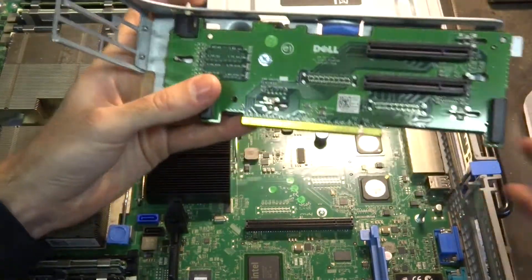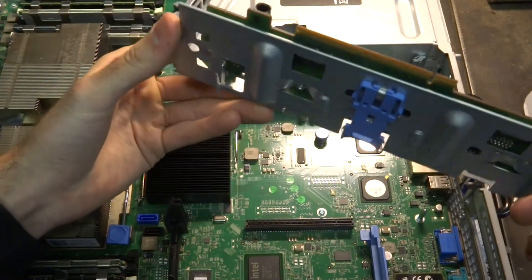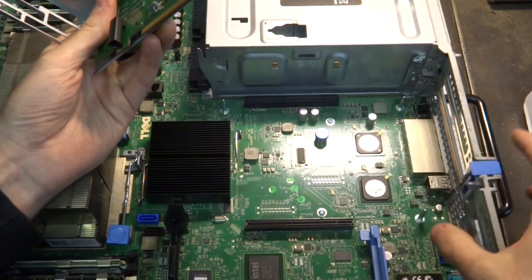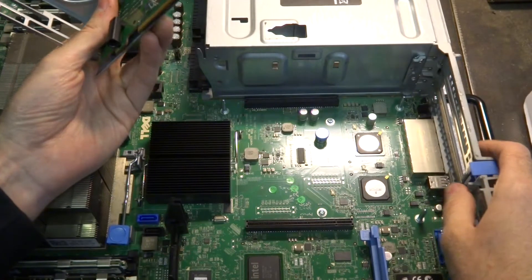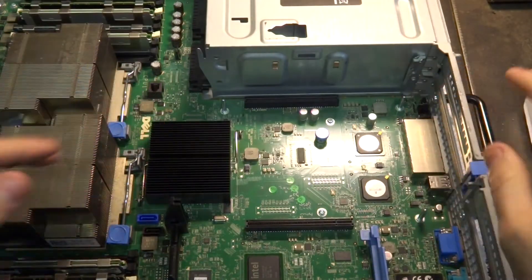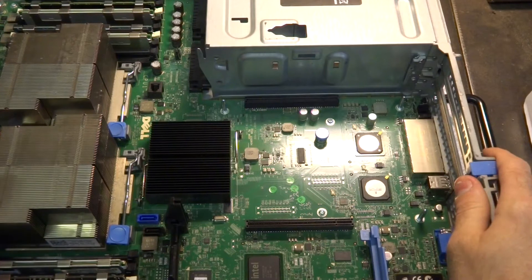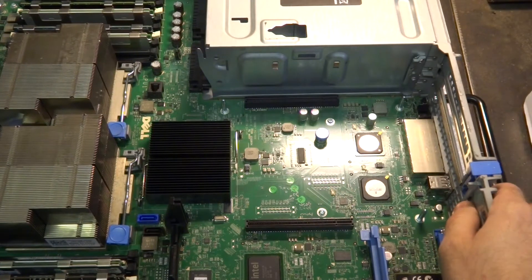It's a shame, because if it didn't have the intrusion switch, you could easily get a PCI riser cable and put in a two-slot height card in here, which would be much better. Maybe there's a way around it — if I can find one I will, because I'd like to get a graphics card in here to do some video transcoding for a Plex server. I can shove all my DVDs onto here and stream them to my living room, instead of faffing around with a hundred and one DVDs in a case. Maybe we'll see if we can find a used Quadro card for that.